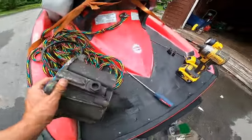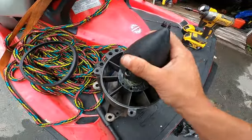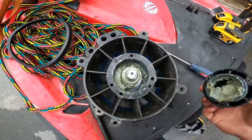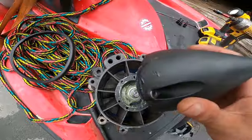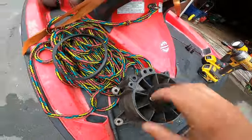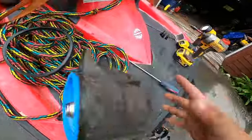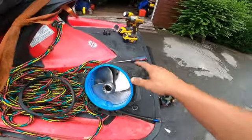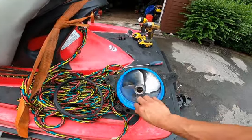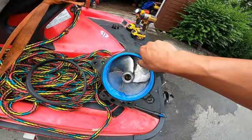So guys, just a little more information. If you've got to pull the prop, you got to pull the shaft. So you got to take the 3 Allen keys out of this cap, and you'll find there's a 1" or 1 1/16, something like that, fairly large nut inside there. Once you bang that off, then you should be able to either slide the shaft out, or if it's nasty you might have to press it out. And then the last and final stage is you take this thing, you go put it in your deep freeze, you let it get really cold, and once it gets really cold you should be able to slip the wear ring out with your hand.